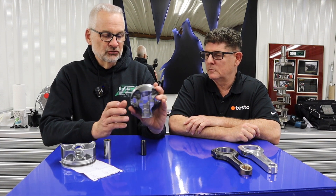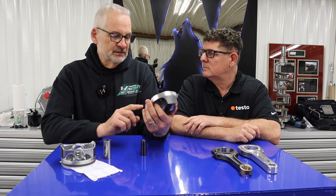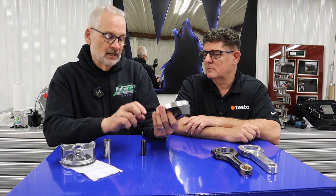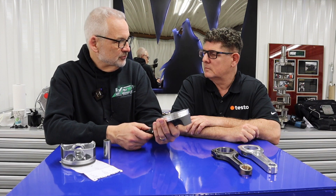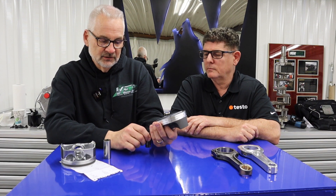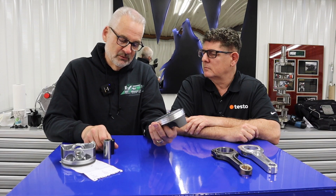When we look at what we're doing now, we're going to be spinning this thing north of 9,000 RPM, so obviously we have a little bit more valve relief in it. It is a billet piston. It does have gas ports. The pin diameter on this is about 20 millimeters versus about 25 for the stock pin, and of course quite a bit shorter.